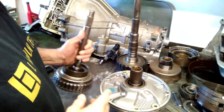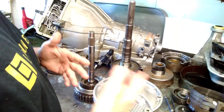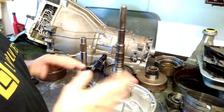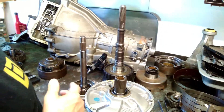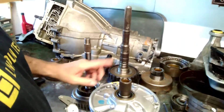I'm going to show you the procedure for measuring one set of bushings. A good rule of thumb: if you have to change out two or three bushings, just do the whole set. They're pretty cheap, the customer gets a better overhaul, and you're not lying awake at night wondering if that thing is going to come back in a week or two all burned up. Just do it right the first time.